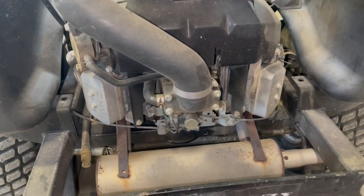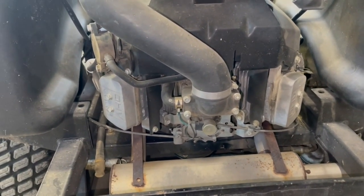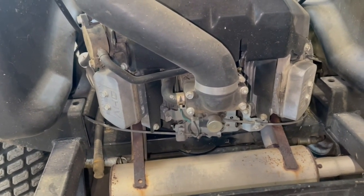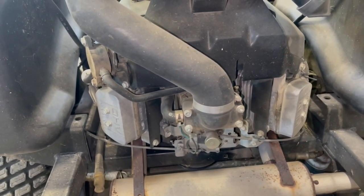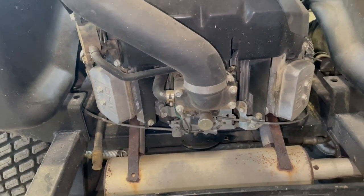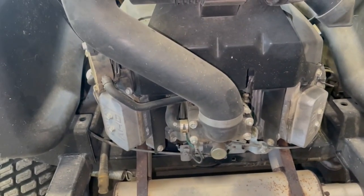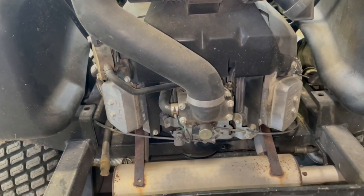Welcome back to the Belted Galloway Homestead. I put a short out the other day stating that my Cub Cadet M60 is running rough. It's running rough under load — when it's sitting here with the blades disengaged it runs smooth, but you engage the blades and move around and the problem is intermittent. It'll really start running bad and start backfiring through the muffler. If I back up I smell some raw gas, but I never see any coming out. If you apply the choke any, it wants to die.